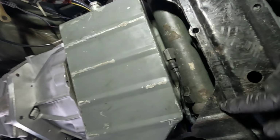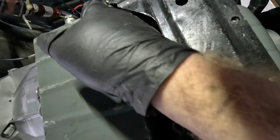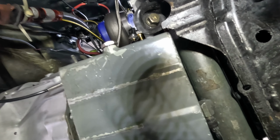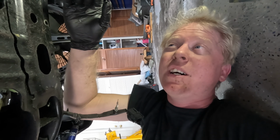Okay, well, I've officially completely lost track of time while getting this engine straight. And, well, needless to say, push came to shove and sacrifices had to be made. If you look closely, this subframe here does not sit straight with the engine. I mean, you can even see how close this is over here. That's not normal. With that said, I had to cut this little corner off of the subframe to give me just enough room to allow the engine to torque as it may need to, and hopefully that'll be enough so it won't puncture the oil pan, drain out all my oil, and leave me starved of oil. Until I can think of a better way to fix that, that's gonna be what it is. I'm kind of stuck here, literally.